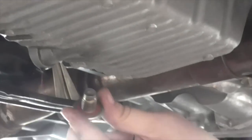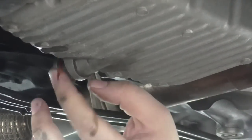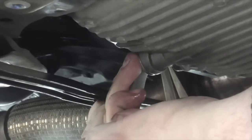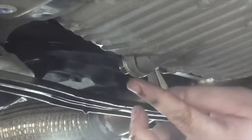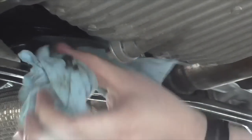Alright, let's see which way it's gonna go — hiyah! Perfect. Now we'll wait. Alright, so now since the oil is draining down to just a couple drips, put the plug back in and make sure you don't over-tighten it. You wanna make it snug — you don't wanna over-tighten it, probably no more than like 20 pounds or so. We're actually gonna use just a wrench to do that. It has a rubber gasket in it, so it's actually gonna seal even when you don't over-tighten it like some idiot did.